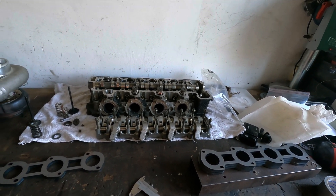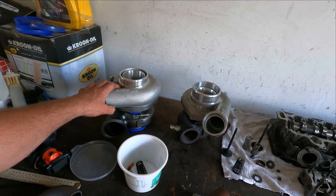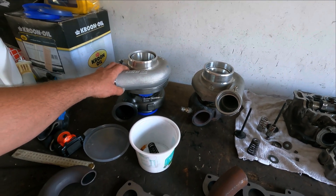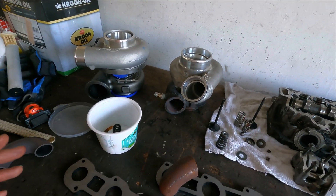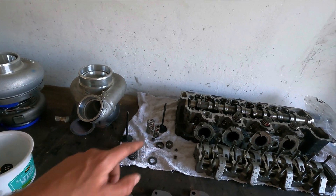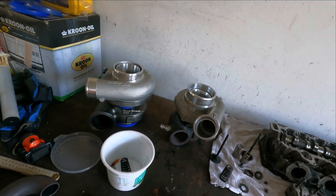What I'm also going to do is upgrade the turbo. This is a Pulsar 7170G - that's like a copy of a Garrett G40 1150. This may not be strictly needed, but for the upgrades I'm going to do I thought it was necessary because I want more than 500-600 horsepower. The conclusion I have with this engine is because of the big exhaust valve and spring pressure, you cannot run very high back pressure. I think even when you run the small turbo with double springs, you will hit a point of too much back pressure. My back pressure was already 1.7 bar with a boost pressure of 0.7 bar - so almost over two times the boost pressure on the intake side.